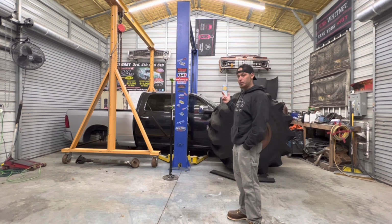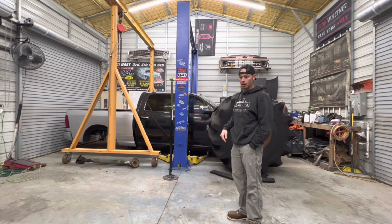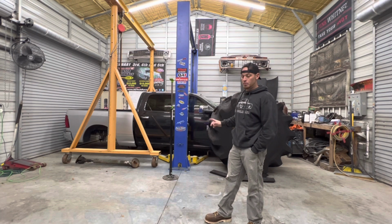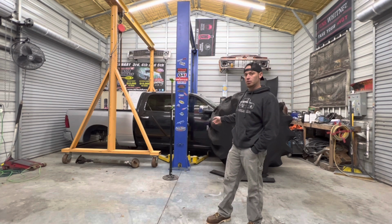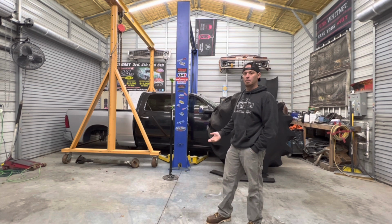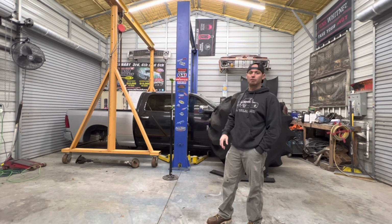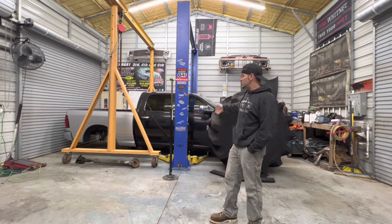I'll run this thing up for you so you can hear it and see how fast or how slow it is, and I'll bring it back down at the end of the video so you can see how slow it is. One other thing that I'd say about these lifts, some of them that have the same style lock that are different brands or whatever, I've noticed people snatch the cables. Whenever you unlock the locks, you have to lift the vehicle up a little bit, and people will be snatching on them before they ever do that, and they'll wear the cables out and end up having to disable their locks, when really all you gotta do is go up to it and you can pull it with one finger. They have no issues. But I'll go ahead and run this thing up so you can see it, and we'll go from there.